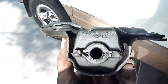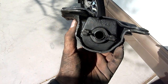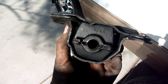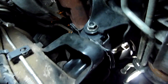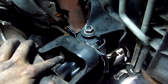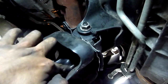You can see right there it says 'made in Korea.' So that's it for that side. I'll get the other mount in and then show it bolted up. This is the driver's side engine mount that I just replaced. You open all three bolts that hold the engine mount with the rubber grommet in it — there's one bolt in the front and two in the back.